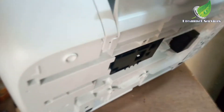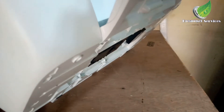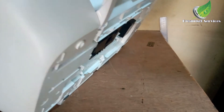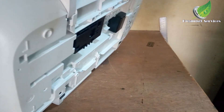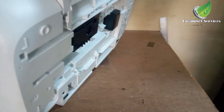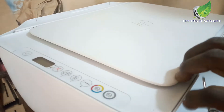I'm going to take out the two screws at the bottom towards the paper outlet area. Just remember it can be different on your own printer depending on the kind of printer you're using. Whatever you're doing, make sure you get access to the scanner cables — that is the part you're going to be working on. Detach the scanner cable from the motherboard, clean it up, and put it back. That should be able to resolve the issue.